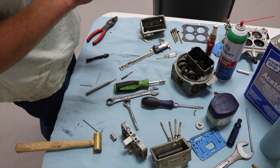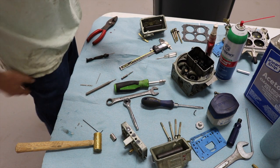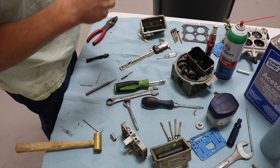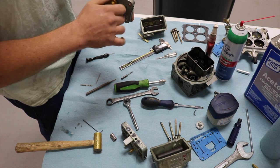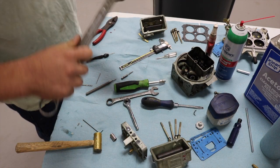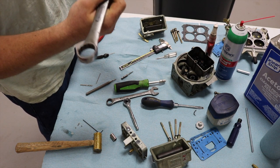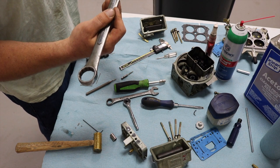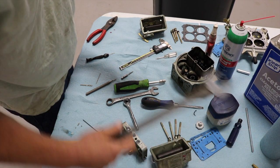These power valves have O-rings on them, they are E85 safe — I'm not going to run E85. I don't have a fuel pump to supply enough fuel where this thing should hopefully go. With how low the boost pressure is going to be, I'm just going to run it at what they set that screw at, because essentially that screw changes how much pressure it takes to open this. I think they come set about one or two pounds. I have the AFR set relatively rich already, so I'll just run that in. I don't want to go super tight with this because I do have to pull it out every time I want to make an adjustment to the power valve channel restrictors.